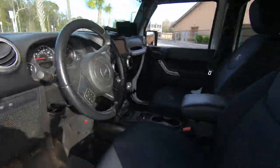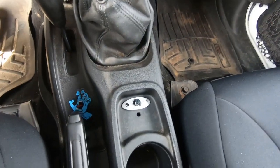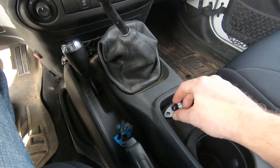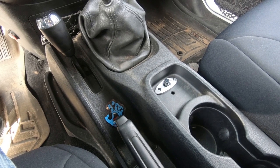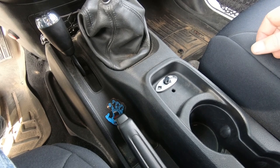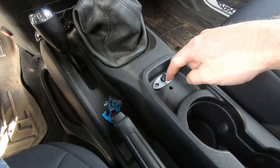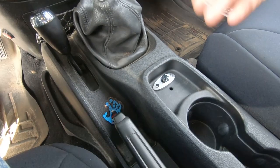Something I want to show y'all — the bass controller. What I decided to do is flush mount it into my center console here. So when I'm driving, all I can do is reach down and adjust it as necessary. It's definitely necessary from different types of music, track to track — I have to turn it up or down to where it's just right. All I had to do was cut the back off the encasement with a Dremel and then drill a three-quarter inch hole and slot it to make it fit.